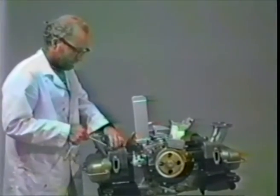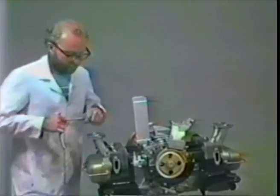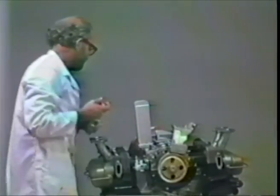So tighten the plug down now that you've got them screwed in slightly by hand. And don't overdo it. Use a calibrated arm technique, or if you want a torque wrench, and torque them down. Of course, the factory wrench that comes in the toolkit for the car actually works pretty well. It's a little awkward. You have to put a screwdriver through it to turn it, or a T-type handle.